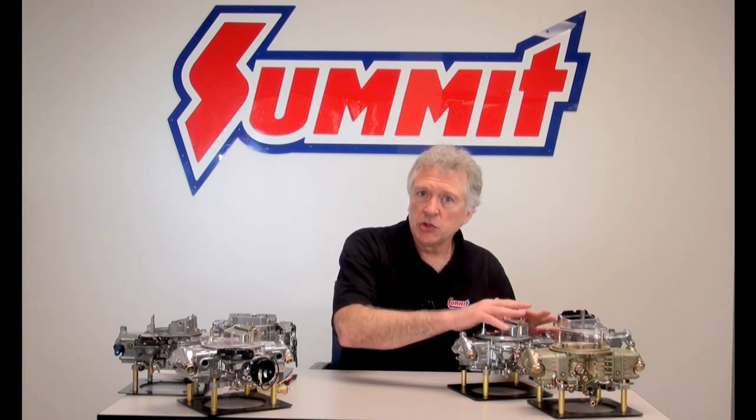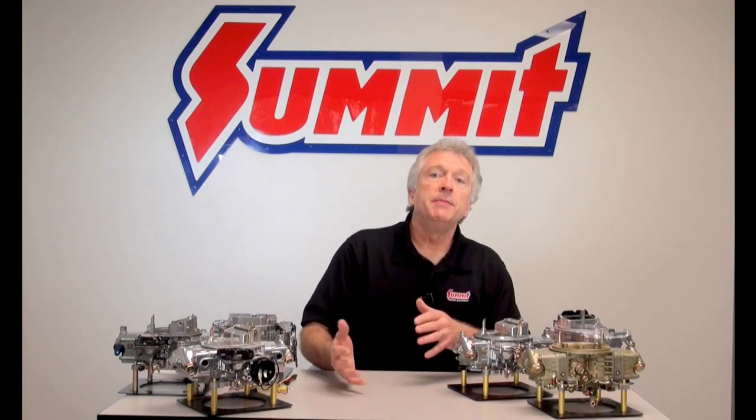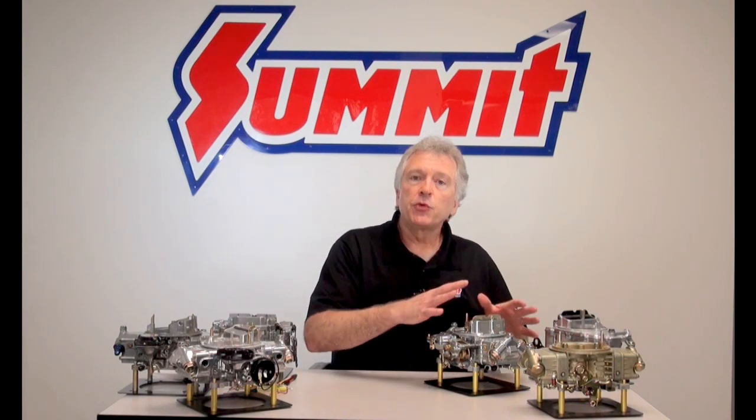So that's kind of an idea of what's going on with the choke circuit and why we need it. It gives us a lot of gas, puts that gas down into the chamber, and by getting a good spark to that fuel and having that happen at the right time in the timing event, we get combustion. The motor fires and two, three, four minutes later we're at operating temperature. At that point, I can turn my choke off and allow the leaner condition and my previous settings that I've dialed in on my carburetor to come back and take control.